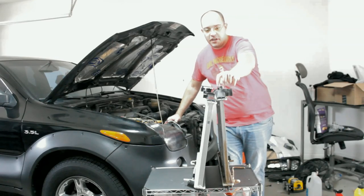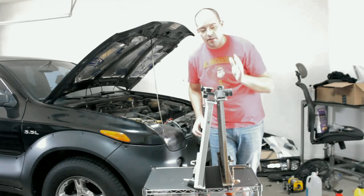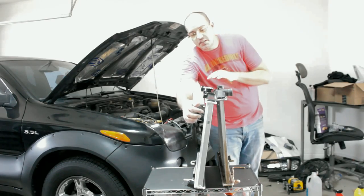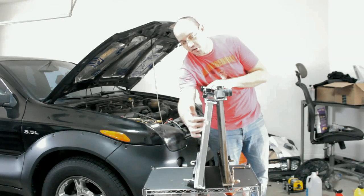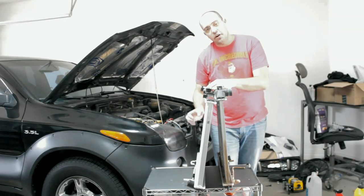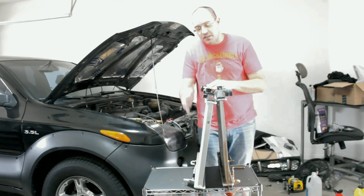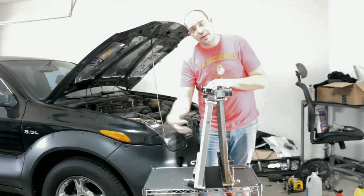The stock radiator I'm taking out of this vehicle, you can see, is quite a bit thinner than the one I'm going to put back in. That's because the new one is a two-row versus a one-row radiator. Instead of one row of heat exchanger material, there are two rows, meaning more capacity for water, more metal, and more surface area. That surface area is probably the most important thing — it increases the amount of metal for the air to touch as the fan pulls air through.